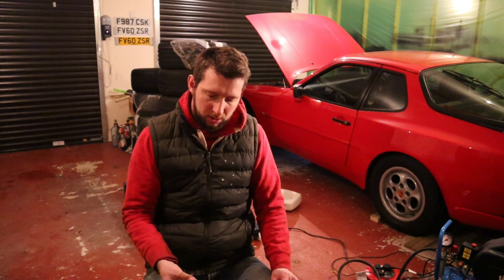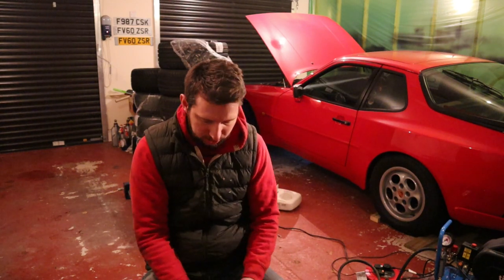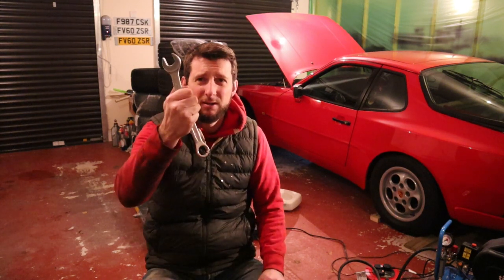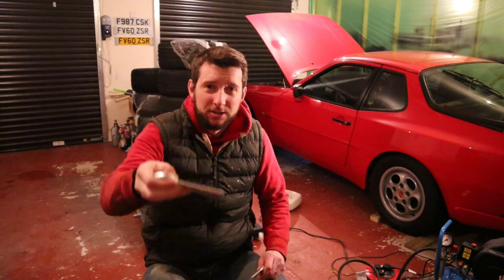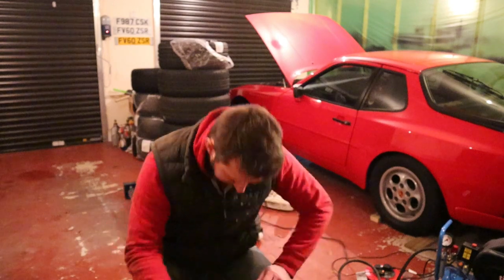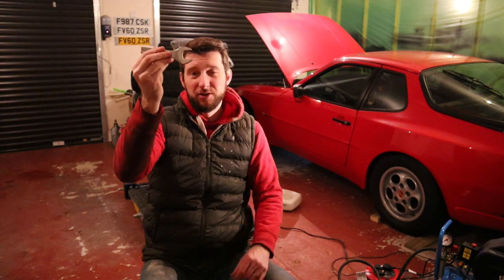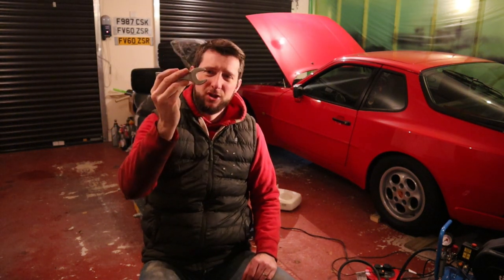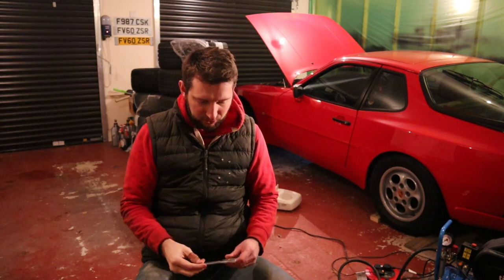So another option of trying to get this off is to get your 24mm spanner and take an angle grinder and cut it in half. You can see there — just cut it in half, round off the edges so you don't split your hand. That should allow enough access to get in from underneath. You just need to break the seal on it and then you should be able to untighten it with your fingers. So let's have a go at doing that.